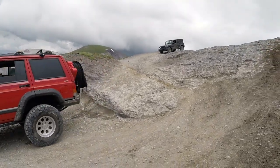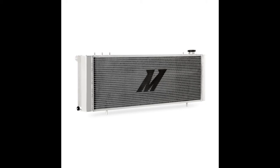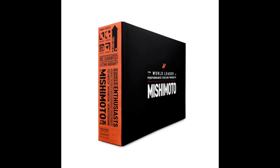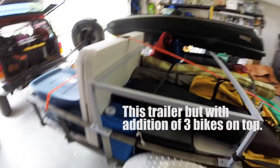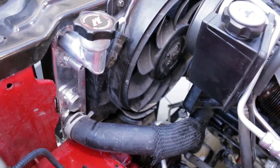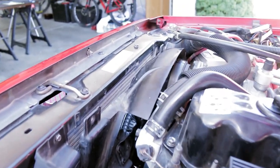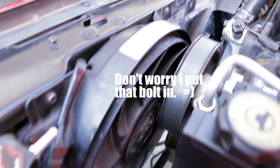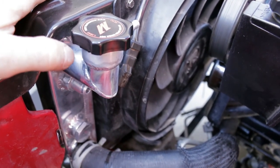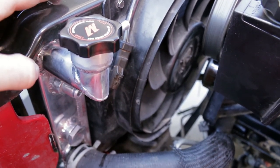Coming out of the Verde Valley, there's about an 18-mile hill up to Flagstaff with 5% and 6% grades. In 80-degree weather it might get to 215 going up that hill with the air conditioning running — couldn't do that before. Last week I did some towing with a trailer, about 1,500 pounds, in 90-plus degree weather. Temps stayed at 206 on the freeway. On the hill coming back up it touched 218, but I'm running AC, had it floored, and topped the hill at 65. Couldn't have done that before.